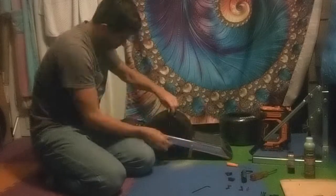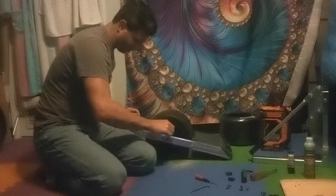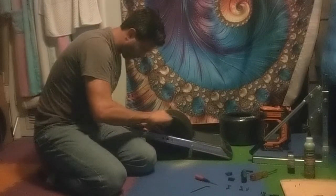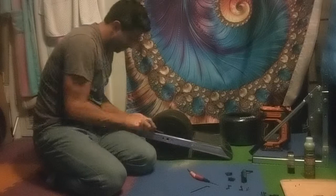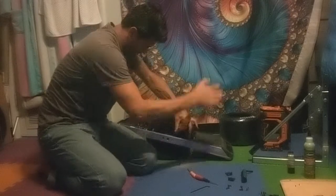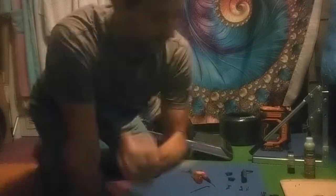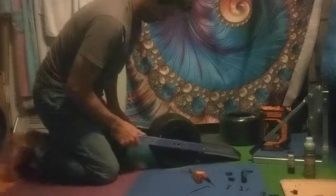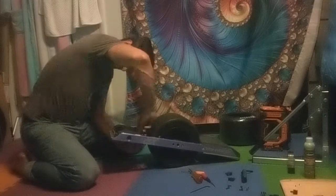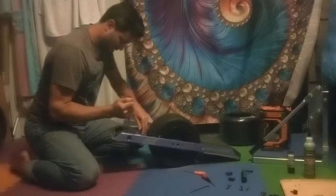Here's a really important step. These are two screws that hold on the little plate that holds down the wire that goes from the battery up to the controller. These are really tough to get out — I've actually had to use a special screwdriver before. Definitely be sure that you can get that off before you even try this whole process, because you might be stopped in your tracks.